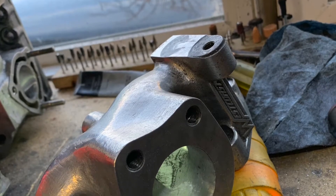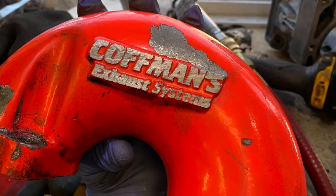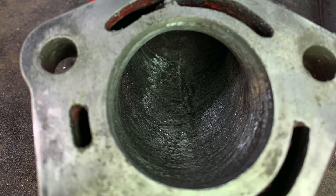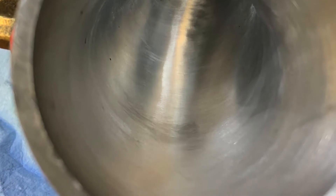This is a West Coast Performance exhaust manifold. Even though it's a performance part, you can see there are some casting marks in it. I then moved on to the next part of the exhaust, and here you can see it is quite rough as well — even though it is a performance part — with lots of casting imperfections. And this is what it looks like now after going at it for several hours with a carbide bur, sandpaper, drums, and a homemade tool which I will show you right now.